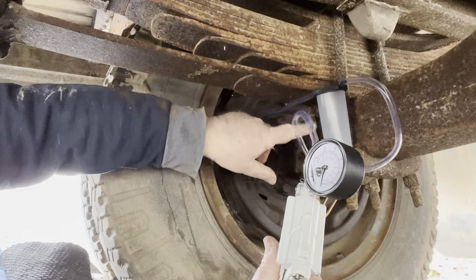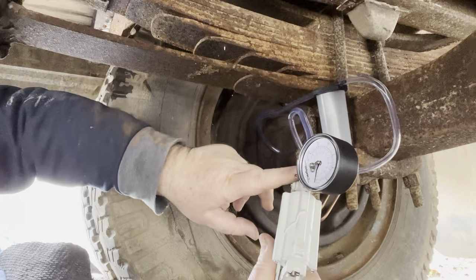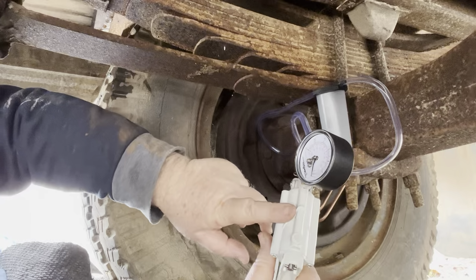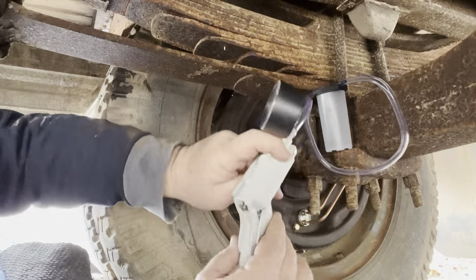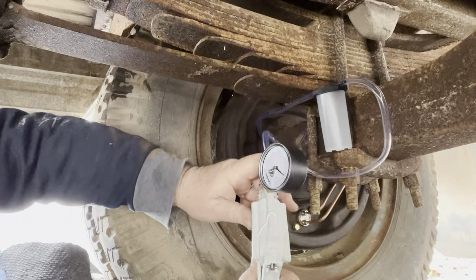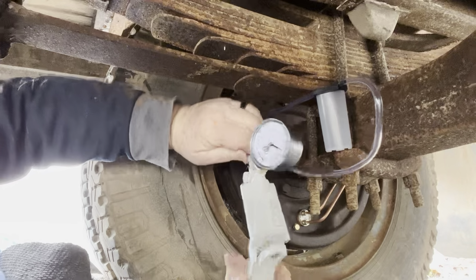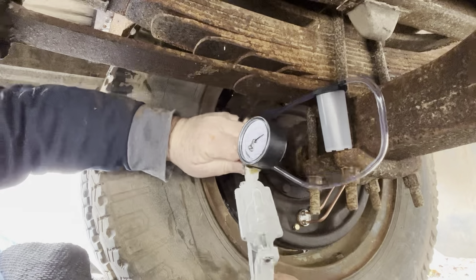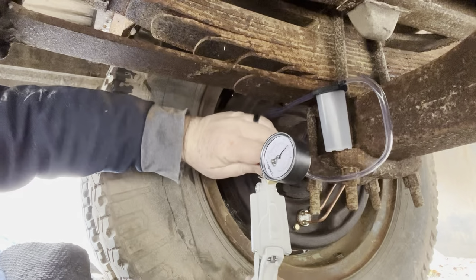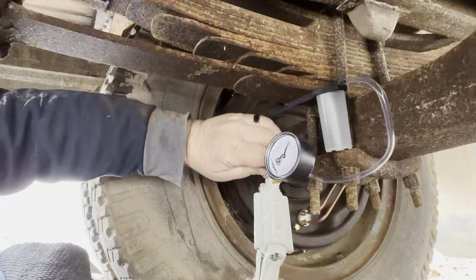There's a hose in here and the vacuum line, because whatever you do, you don't want the fluid to get inside here. Fluid inside here is bad. This is for making air vacuum, not fluid vacuum. So let's suck it. Whoops, I hit the button. All right, so we're at 15 pounds of vacuum. Let's get it up to 20 and give it a crack.